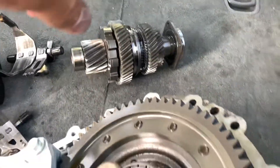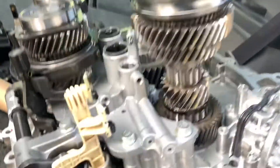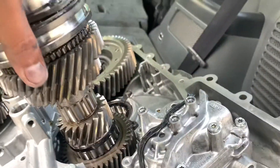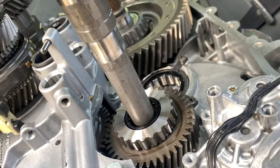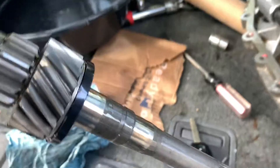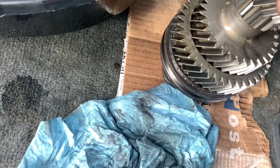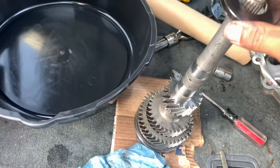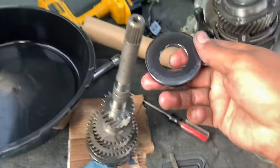I'll pull these out — I had to pull it from the top ends. I'll slide it and that should come off too. I lifted this part out as well. I have the other shift fork right here. Now to lift this up, you have to be careful because there's also a bearing that wants to come off with it. There you go. And I believe this ring will come off too — see this ring. I just pulled off this one right here and these are two pieces, and that goes right on here. You don't want to lose that, so I'll put it back right here.